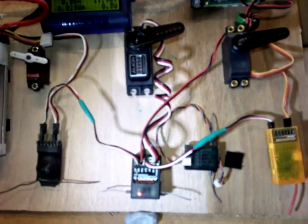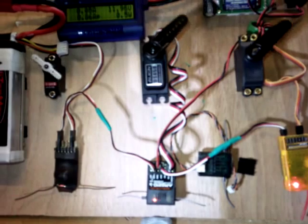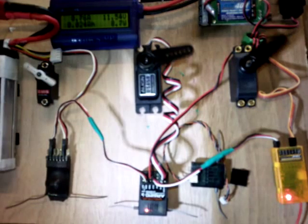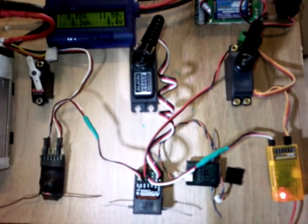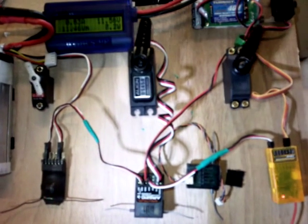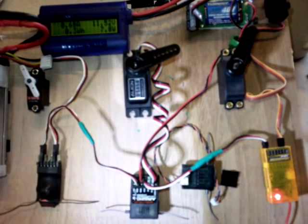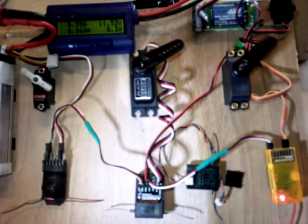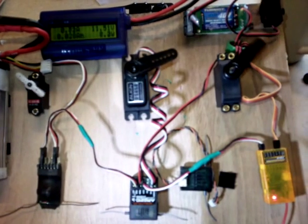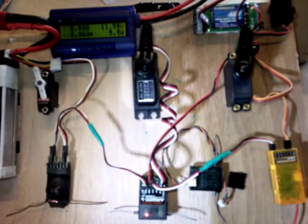Now, what we're going to do now is see how these perform when we keep it at such a low voltage, to see if they manage to keep up and keep operating those servos. And now you can see that I'm waggling the throttle quite quickly, and I can see that the orange unit and the unnamed brand are actually keeping up, but the AR6210 is really struggling. Okay, now of course we've got to take into account that we've got different servos here. Possibly a slightly unfair test.